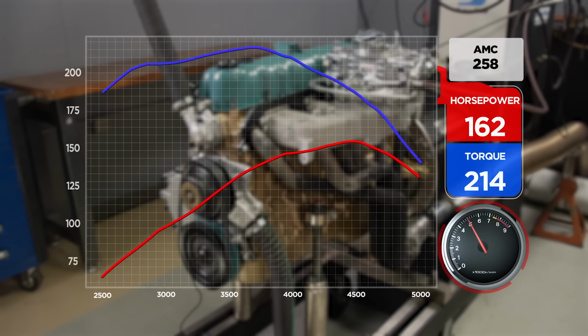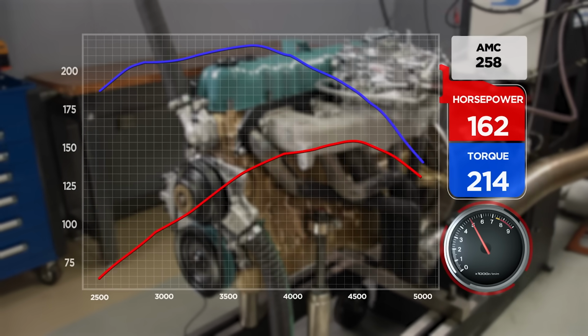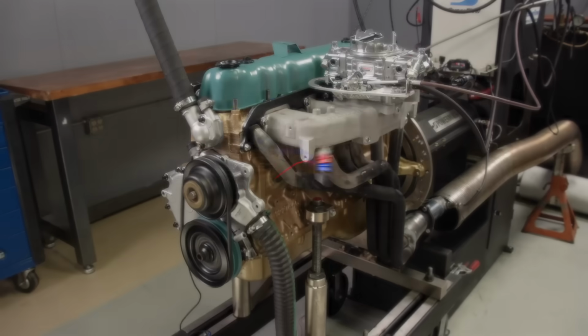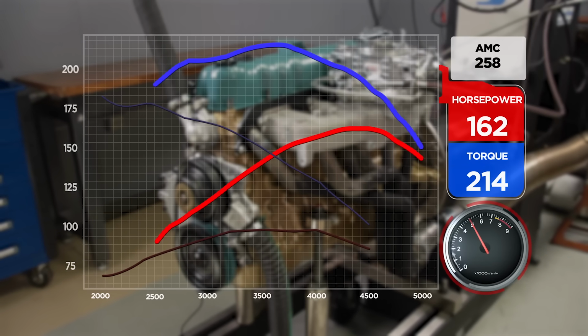It did it. Barely did it. It was kind of complaining. Things with low cylinder pressure like this, it has a measured compression ratio of 8.13 to 1. When you're dealing with something with this amount of power, which is low, any incremental change is a large percentage gain. Okay, so we were at 101 horsepower before. Now we're at 162. That's our power difference right there.